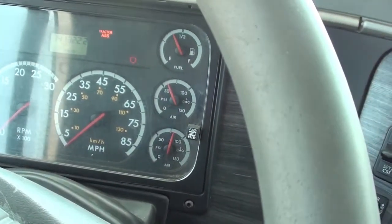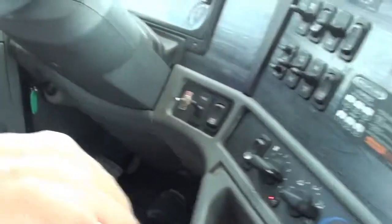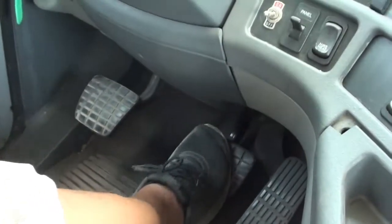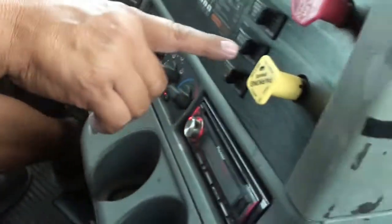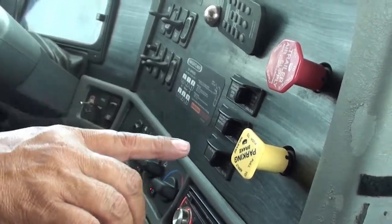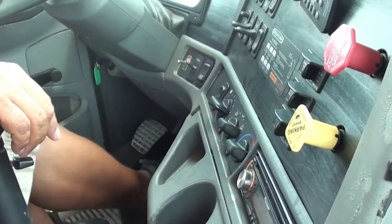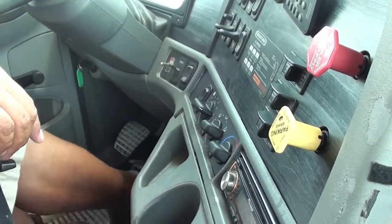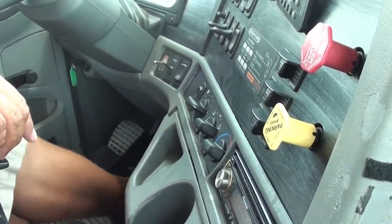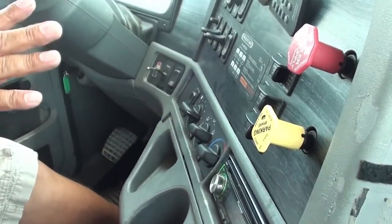Now you're gonna tell the examiner that you're gonna continue pumping, and between 40 and 25, my valves are gonna pop out. Those valves, do not touch them. They need to pop out by themselves. And you continue pumping until they pop out. You can do it faster if you want. The faster you do it, there you go. Both popped out, that means they're working.